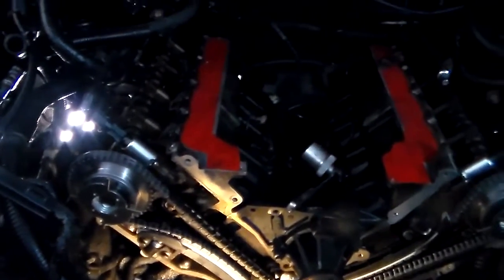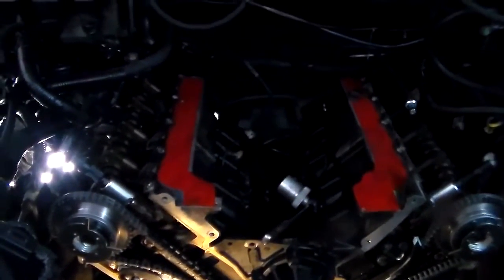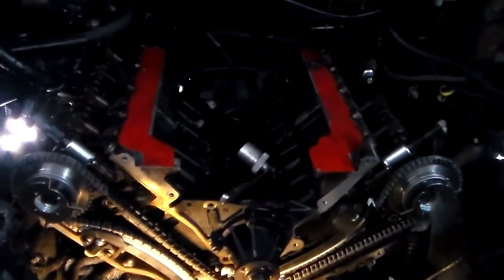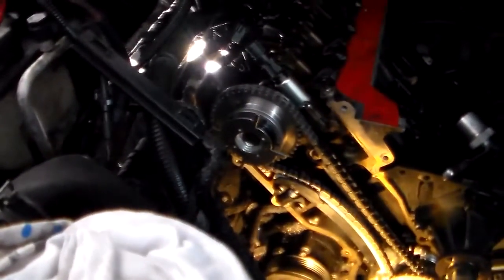And I found it easier to take the intake off to do this job, because the intakes really aren't that bad on this vehicle, and remove the fender skirt on the passenger side. Saves you from having to take the computer out and disconnect the harness. I guess some people take the AC off too, or disconnect it and discharge it, but I was able to get to the last bolts down underneath, down there. And some more stretch bolts.